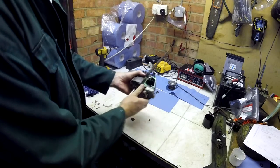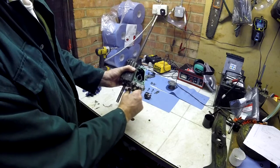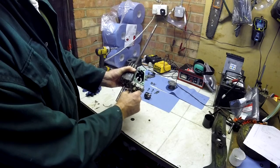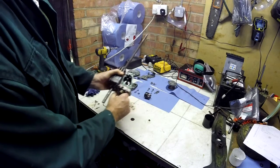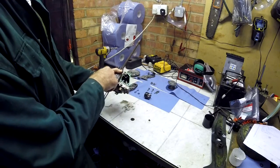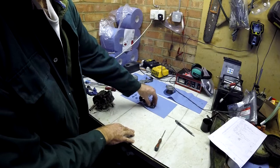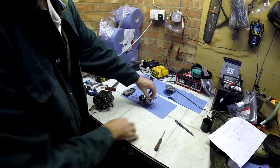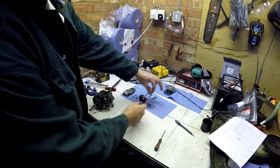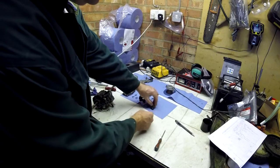And you can see the swash plate in here and its function against the control cable that comes into it. So that controls the speed of the wheels. And the more you rotate it, the more oil is pumped from this chamber into this chamber. The swash plate itself has a needle roller bearing as its surface driving the pistons, and note that the thick washer goes the piston side and the thin the other side, and the bearing in between.